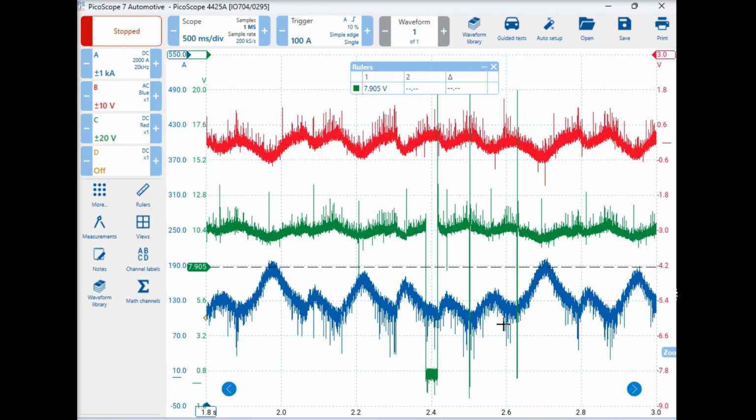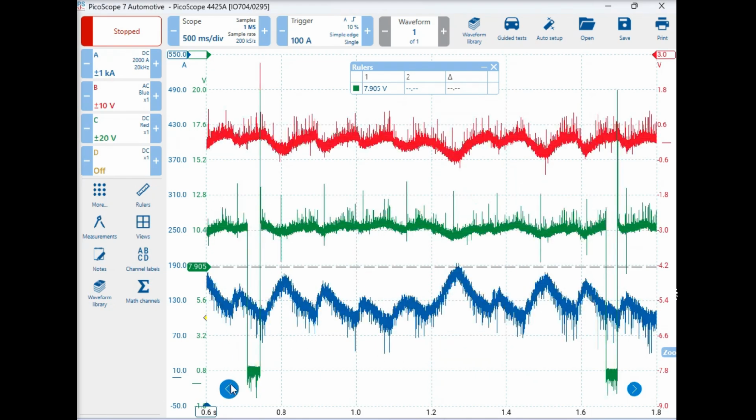Harley, what do you think? We use our injector pulse to work out which stroke we're on. Right, that's our injector pulse there, good. Yep. So the one before this would be the compression stroke of cylinder number 1. Right, okay, good. So how's that helping us though? How does that identify the rest of them? So now we can go through manufacturer specs to calculate which ones would be in our firing order next.